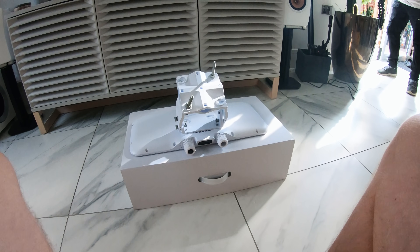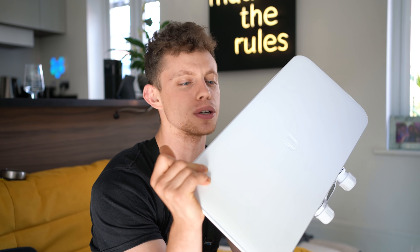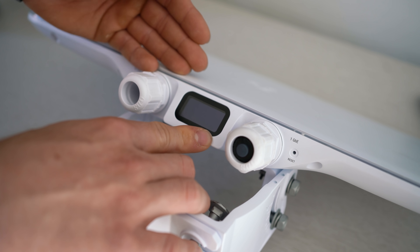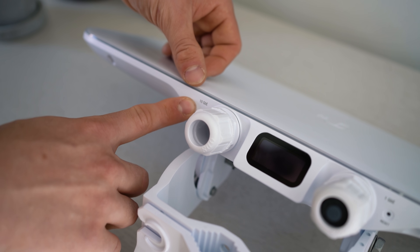It's a few days later — I've got the GoPro strapped to my chest — and it's time to end this video by putting this monstrous AP on my roof. This is called the Base Station XG from Ubiquiti, and this is actually a little bit overkill — it's completely designed for things like stadiums, football stadiums, densely packed areas. This is an absolute beast of a radio that can have up to 1,500 clients connected to it at once. I live in a brand new estate where houses are being built right now, so I'm going to provide some free Wi-Fi for people to connect to, because people might not have got their broadband moved over to their new house yet. Looking around this access point, there's a screen on here that will display things like how many people are connected and the current IP address. We've got a one gig port over here, and because this access point can support so many clients, there's actually a 10 gig port on this side, which is pretty insane.